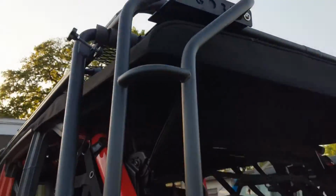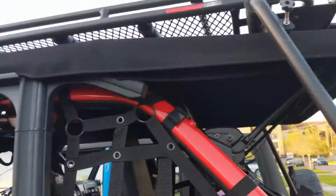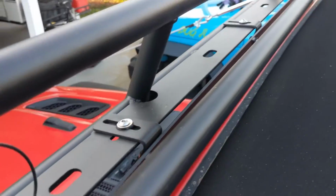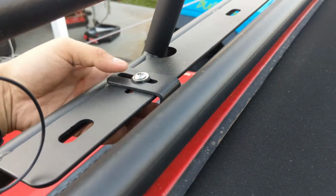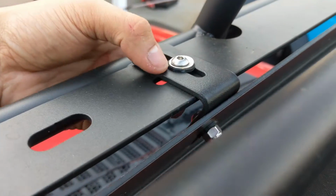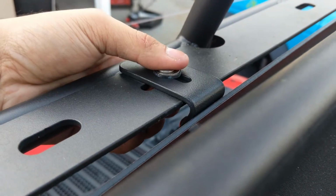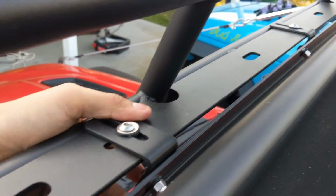So now if you have a ladder, you can put that on, make sure it fits perfectly, and if you have the windshield deflector, you put that on as well. There's a certain amount of distance you're supposed to have for the nuts to the end of the bracket. I ended up getting some metal washers as well to put over these plastic washers, because I found that this kept moving regardless of how much I tightened it. So I got it tight, and now it doesn't move, and it's perfect where it's at. And after that, you're essentially done with your install of the rack.